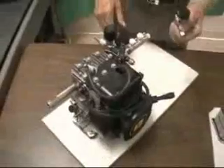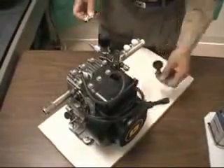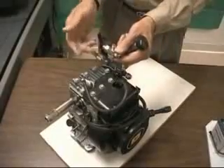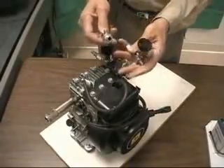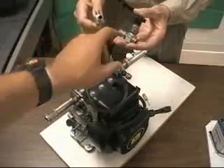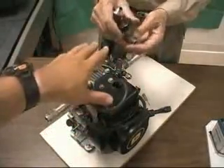What we're also showing is the ability to run this by setting up one valve as the idle valve — you can set up the idle RPM at say a thousand RPM. So basically we're running hydrogen through this fine control needle valve, and that's just enough to keep the engine spinning at idle.